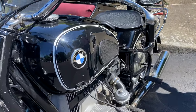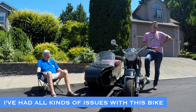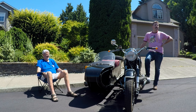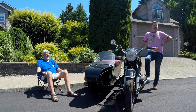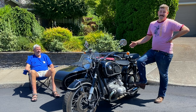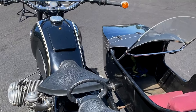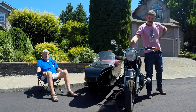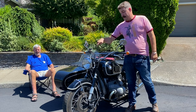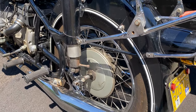I've had all kinds of issues with this bike. On the slash-2 BMWs they had two separate circuits — an ignition circuit and a lighting circuit. I was riding this in downtown Portland to pick up my wife from her office to go camping up on Mount Hood, and the lighting circuit decided to self-destruct in a giant cloud of smoke. Fortunately the ignition circuit was still intact and I could get home. We did a complete motorcycle rewire with Joe Tessitore at Second Gear Cycle up in St. John's. On all old slash-2s, you could start the bike with a number-12 roofing nail, so we got rid of that.